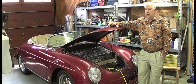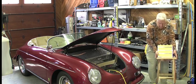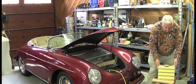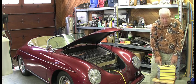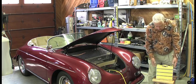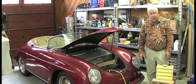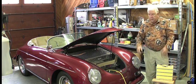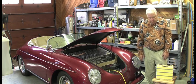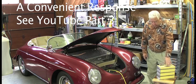That's about a third of the weight and volume of the lead acid equivalent, and they have much higher energy density. This is an example of one of the batteries we have in the car — this is their 90 amp-hour cell. They actually come in individual cells; I have four of them here strapped together with the copper straps you would use to connect them. They have two aluminum end plates and some straps to bind them together, because they do have a tendency to swell under heavy discharge or charge. The swelling isn't really harmful — you want to contain it mechanically, but it doesn't do anything to the battery. These batteries have a nominal voltage of 3.2 volts per cell, giving about 12.8 volts for a four-cell group.